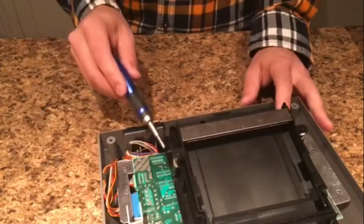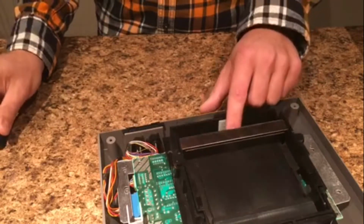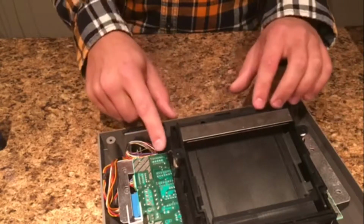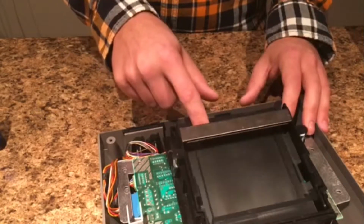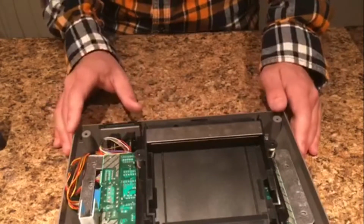And lastly, just this one screw up here, you have to put in a little more loose than normal, because if you put it in too tight, it won't lock down like this because it starts to bend the plastic out a little bit from being pulled on both directions. So you want to put it in really loose, and once it's put in, make sure that you still can do this and that it clicks down, because if you put it in too tight, it'll go down and it'll just come back up like this and won't click down, and that's not what you want.